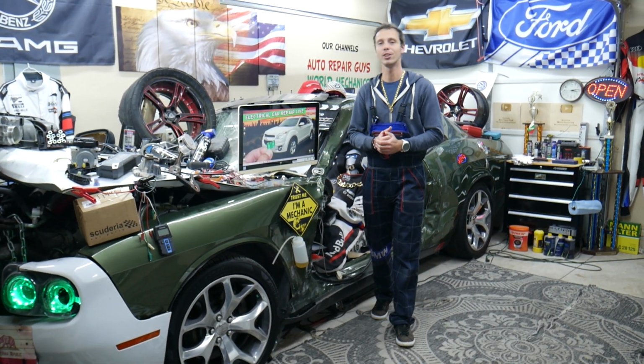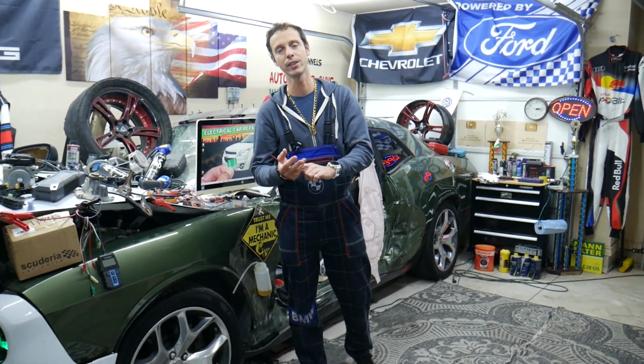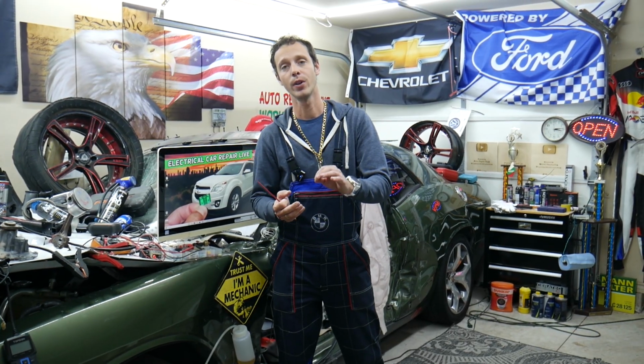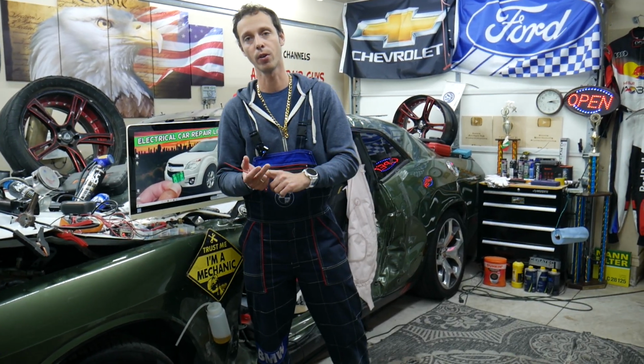For the camshaft position sensor, let's explain something, guys. Before you waste your money on a new sensor, always test your camshaft position sensor. We will have many videos on how to test camshaft position sensors on our YouTube channels. Check it out. Next, what you want to do, check the connector. Make sure it's not contaminated with engine oil or coolant. If you have a coolant leak or engine oil leak, which is quite common on higher mileage engines, it can contaminate the connection. That can cause it to get a code or not work correctly.